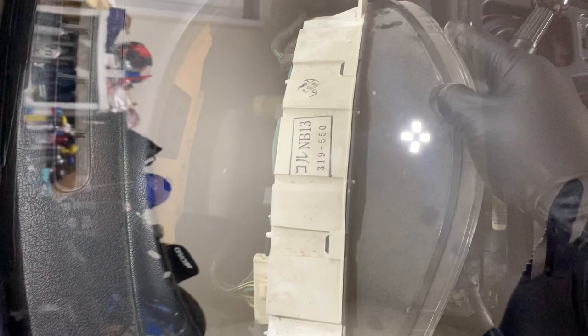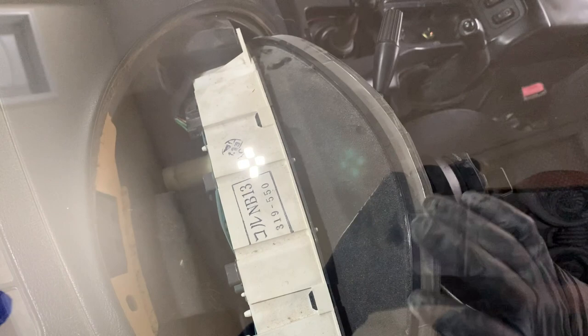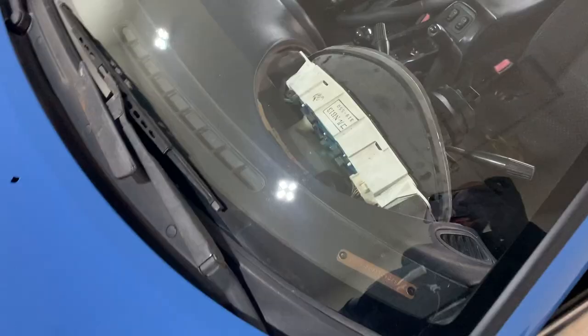We're outside the car now — the speedometer cluster is pulled out as much as it will allow with the cables keeping it in. Right back here where the shop light is — that's your speedometer cable. All you gotta do is remove that little connector back there and then it should pull right out of the firewall once we pop the hood. At this step, if you're also looking to replace the light bulbs or remove the gauge cluster entirely, this is basically the same process — just remove all the other connectors and the whole unit will come out.